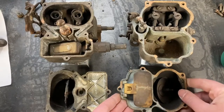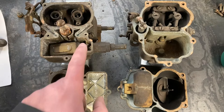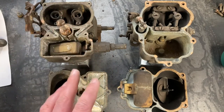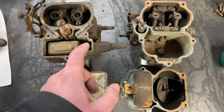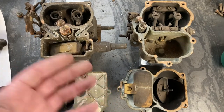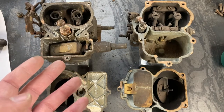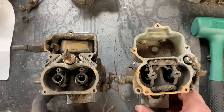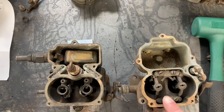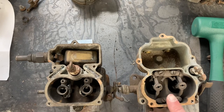There is some debate about which is better. There have been stories that this mechanism isn't the best for circle track racing or any type of circuit racing where there's a lot of lateral movement with the car — this could give you a starvation or a flooding scenario based on the lateral g-forces. But when it boils down to how fast you go into that corner without hitting the wall, I really don't think it's going to cause that much of an issue. The Holley's claim to fame over the Stromberg is that it has a much more efficient design — much better sprayers for the correct atomization of the fuel to the air.